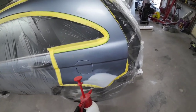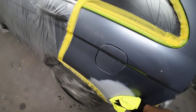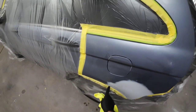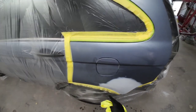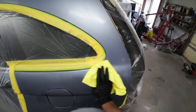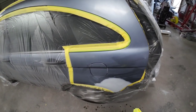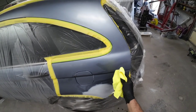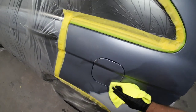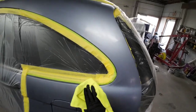The next step is to clean the surface before we start applying our paint. I'm going to use a microfiber towel and 70% isopropyl alcohol. We've cleaned this several times before, but you can never clean enough — you want a nice clean surface. We want to remove any oils or contaminants, anything that's going to limit the adhesion of the paint and the clear coat. It's a good idea to wear gloves because oils from your hands can affect your paint and clear coat.